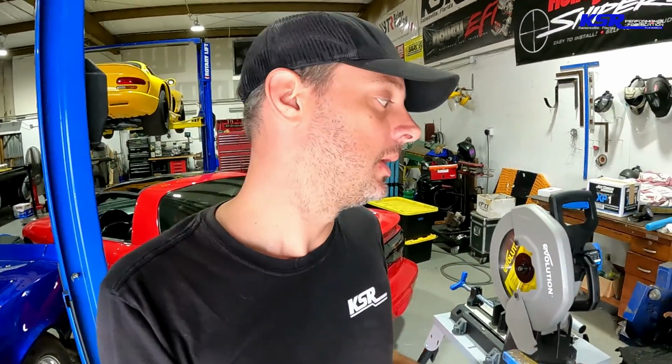Well, as you saw from the dyno chart there, we've got a problem that we need to fix. We need this car to turn 8,300, 8,400, 8,500 RPM or higher. We know the turbo will move enough airflow to keep making power up there. For the car to fall off so hard at 7,900, we've got some kind of issue. So what we think our problem is, we're hoping our problem is, we think our valve springs are starting to get a little weak. So I've actually changed a couple of them already and took some off and tested them.